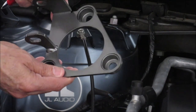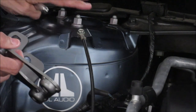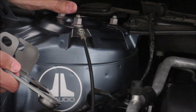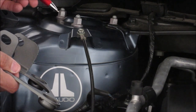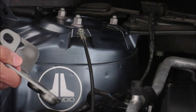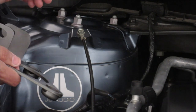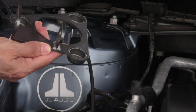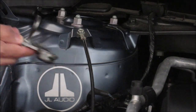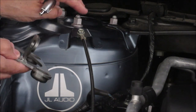The strut bar overall looked very nice. This is a pretty simple installation — it's just a matter of undoing three nuts, mounting the bracket, and putting three nuts back on. You'll need a 14-millimeter socket or combination wrench to remove the original nuts, an 8-millimeter hex key to undo the brace from the support brackets, and in my case a 17-millimeter socket for the replacement nuts.